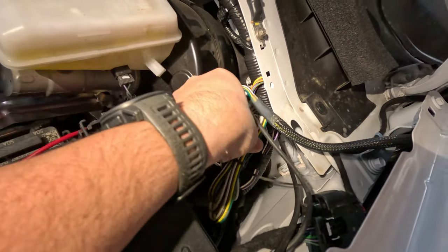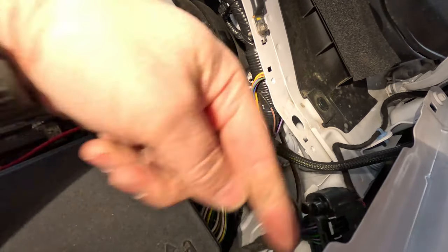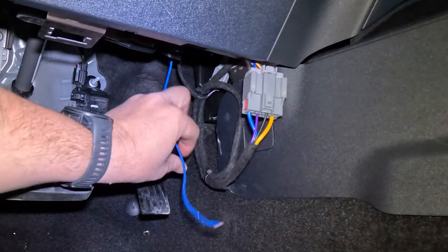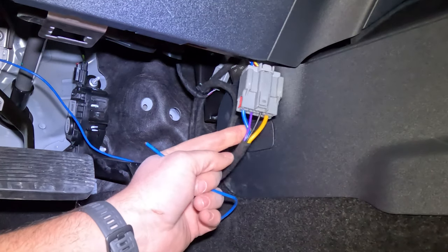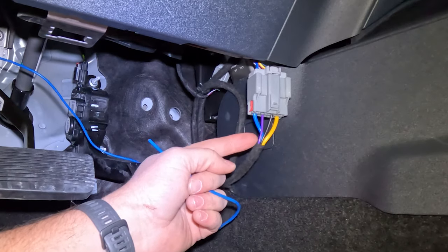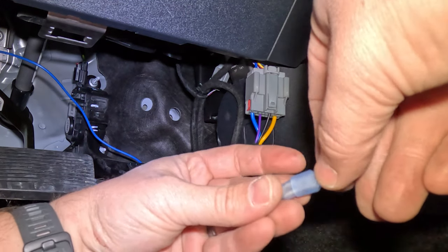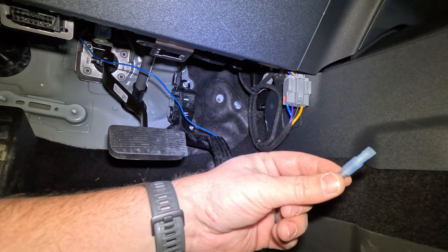Here's our harness for the flat tow, which is going to be another video — that'll just kind of go back up on itself, back around and out of the way. Hopefully you can see this, but you're going to want to run your blue wire up out of the way, and we're actually just going to cut and splice and tie into this one right here. I'm going to come down just a little bit so that if I ever want to tie back into this I can. And then I'm going to be connecting these with just a couple of insulated spade connectors — those will go on there and then we'll crimp those and just tie everything up out of the way.